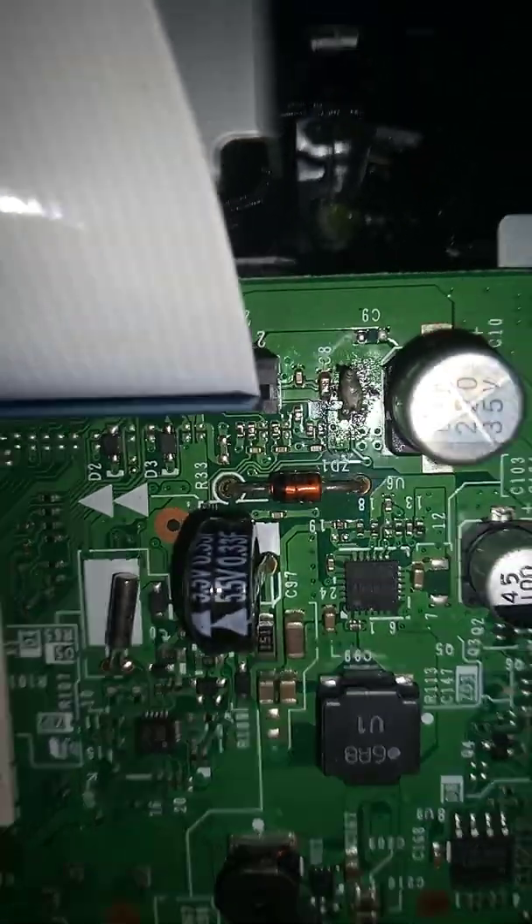This one I've already fixed. There are one or two things you can do: you can either solder in a fuse with a higher current rating. The fuse in this case is rated at two amps — I've got two machines side by side here.